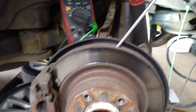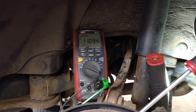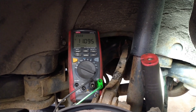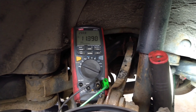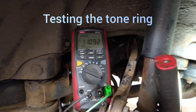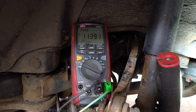This is after cleaning it up and putting in a new sensor. This is a lot like before — back-probed at the sensor. I'm going to turn the screwdriver very slowly and we can see it change as I do it. You can use an oscilloscope and look for dropouts, but this is just showing you a way if you don't have one. We've gone past just testing the sensor — now we're using the car's actual ring on the drive shaft.